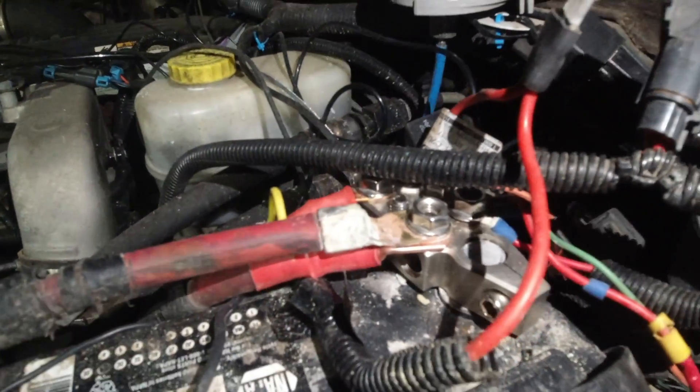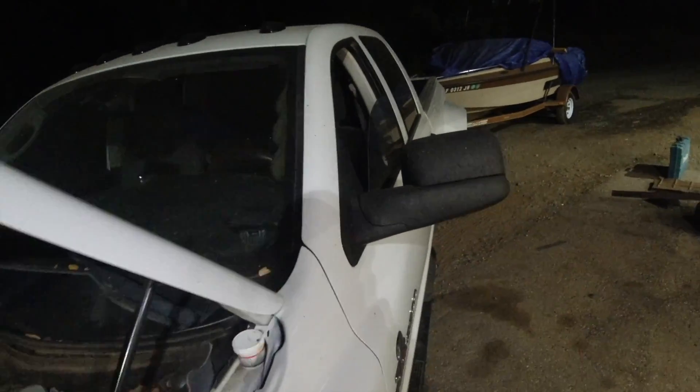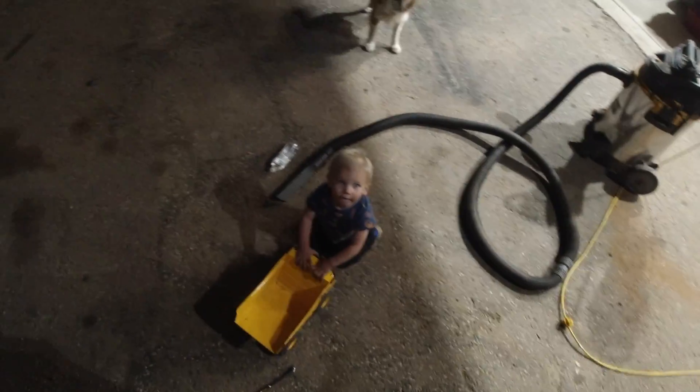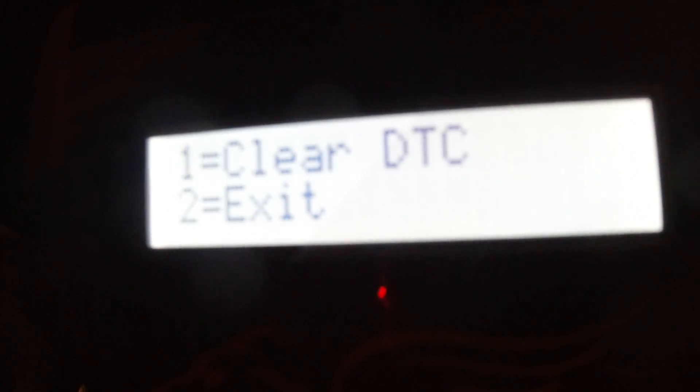Getting dark in deep in there — it's better than it was as far as functionality. I'm gonna hook up the code reader to see if we actually got a computer, because it wasn't even pulling up the computer before, and it just magically cleared all its codes. There it is — five diagnostic trouble codes present. Last time when this happened we lost camshaft position. Water and fuel — not even concerned because I got a FAST. Number five voltage. So we actually got ECM now. DTCs cleared — it wouldn't even give me that option to connect to it before.